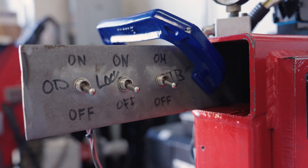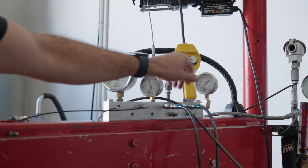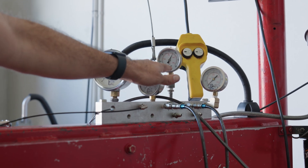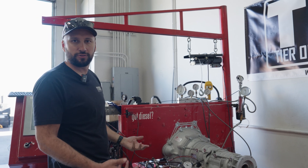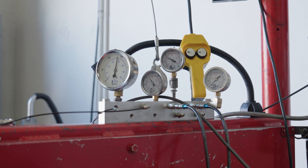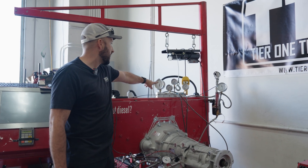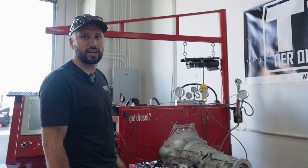You can see I have a little switch wired up here for lockup. As we kick that switch on, you'll see these two pressures will switch. And as you can see, they do switch — our charge pressure drops down to zero and our lockup pressure jumps up to roughly 185 PSI or so, which will keep that converter from ballooning and damaging anything. I'll switch that on and off to show you how fast it actually responds. Our line pressure is remaining constant at roughly 270 pounds, which is exactly what we wanted to see out of this valve body.